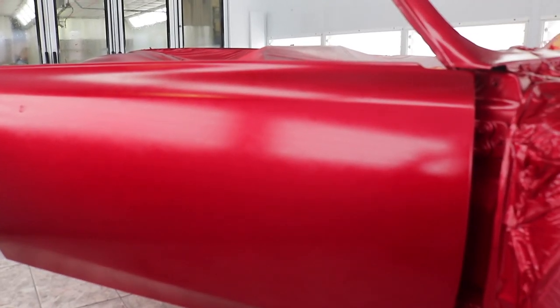Yeah. That's coat 3. I'm having a few coverage issues, but it looks freaking amazing. This color is nuts. I didn't expect it to look this good, actually. I was gonna do a drop coat on my 4th or my 5th coat. I'm gonna do a drop coat now. I'm probably gonna do 2 coats up and down because all of my other coats were side to side. It's really transparent. I think if I don't do a couple of coats the opposite direction, I'm gonna have blotchiness and streaks and stripes.